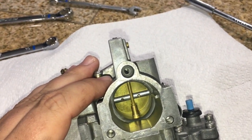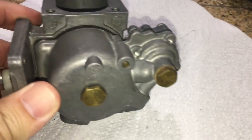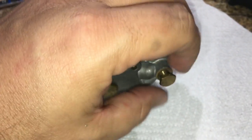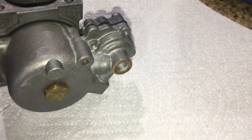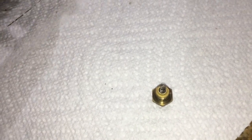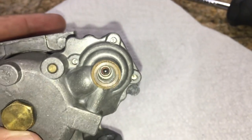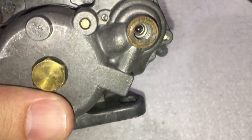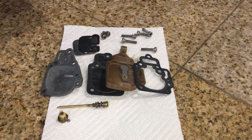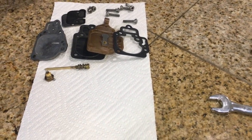I went ahead and removed the idle adjustment screw, and I can loosen these — this one is 13 millimeter and this one is 11. I'm going to go ahead and take them out. There's a washer or gasket on the bottom of that side, and also a little spring and a little ball inside of there — be very careful on those so you don't lose them. There's a little ball that comes out and sits on top of the spring. I'm trying to keep everything in order and the way they faced when I took them out, so I can put them back in the same place.